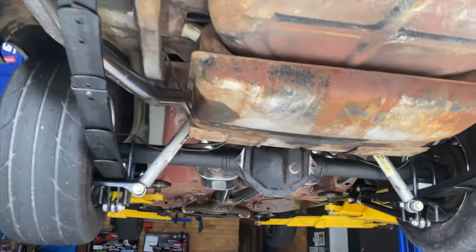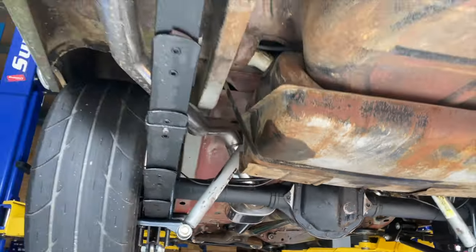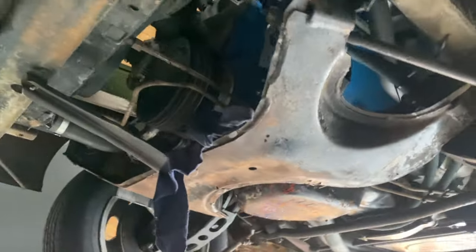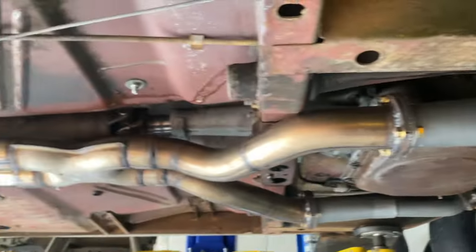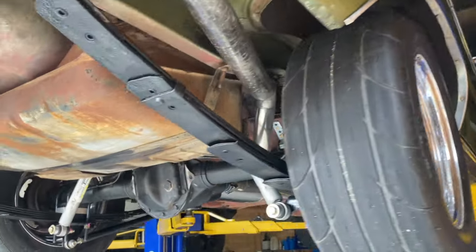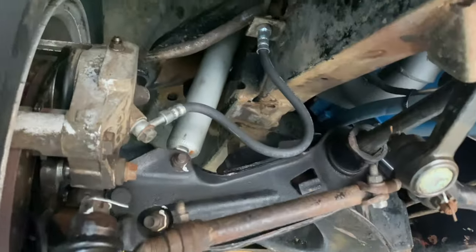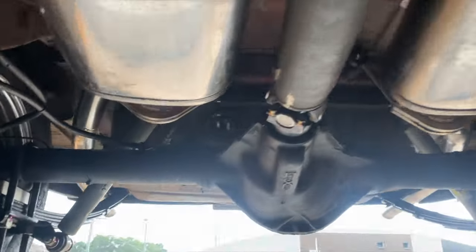Diff oil is checked and done. This car's got a modified Centura diff, so it runs Ford stud pattern. It's also got an exhaust I built a couple of weeks ago — all 409 stainless, mandrel bent, X-pipe, Pacemaker extractors with ceramic coated pipes. It's got a VH front end on it. A lot of the parts came off the VE — diff, Caltracs, everything front and rear — plus Competition Engineering shocks. They're a bit rough for street driving, but other than that it's not too bad.